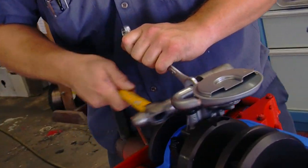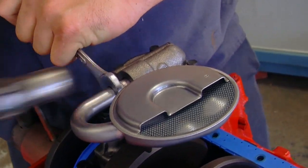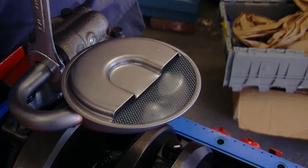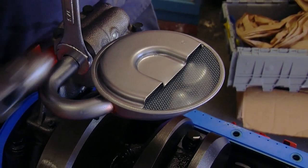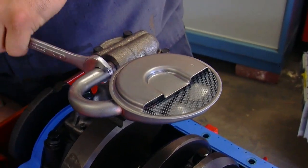If the pickup is too low, at high RPM the oil won't be able to get to the pickup — it'll cavitate and you won't get enough oil pressure. And if it's too high, the oil may end up dropping below the pickup, you'll pull a bunch of air, and you won't have adequate oil pressure, which will hurt the engine.